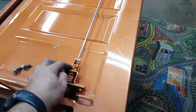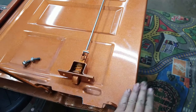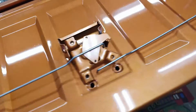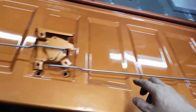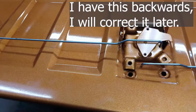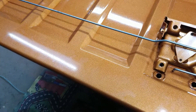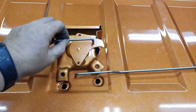You'll notice this embossed boss thing right here is going to be facing up if you're doing it this way with the tailgate on the truck. Then you come over here in the middle. The rod coming from the passenger side is going to be on top when you stick it in here, because when you slide this latch under, it'll be really hard to get to the other one. So it'll be just like that.